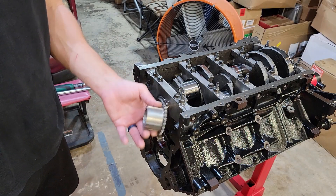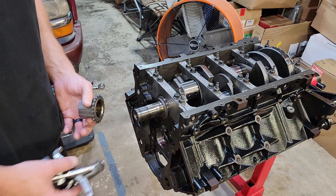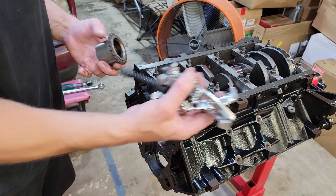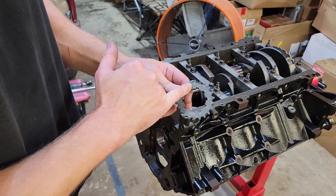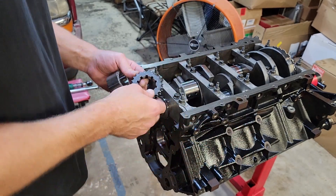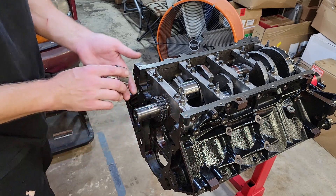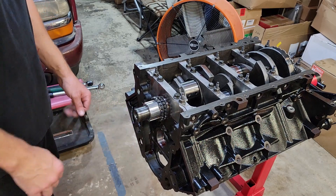The old timing chain gear came off pretty well — this is what drives the oil pump as well, it's an integrated unit. I did have to modify my three jaw puller a little bit — ground down the tops because I couldn't get behind the gear, but it worked great. The new design for the double roller chain has a whole bunch of different increments you can set to change cam timing. I'm leaving it at zero, which is stock. The nice thing is they don't need to be pressed on — they just slide on, and then you have a separate piece for the oil pump which also just slides right on.